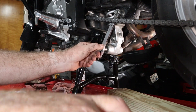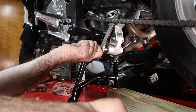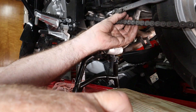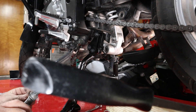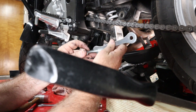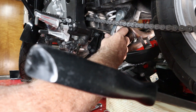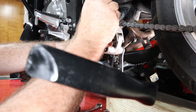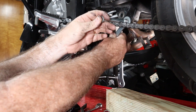They fit in here rather tightly. I've got a strap holding the rear tire up as well. I'm going to feel quite a bit better having the OE dog bones back in here — the original Suzuki ones. I'm leery of a lot of aftermarket products. Now to get this in, I'm going to have to adjust the rear tire up or down just a little bit to get the alignment right.